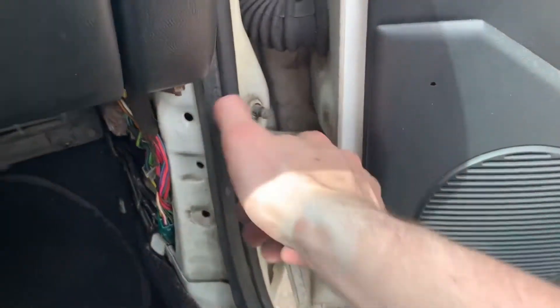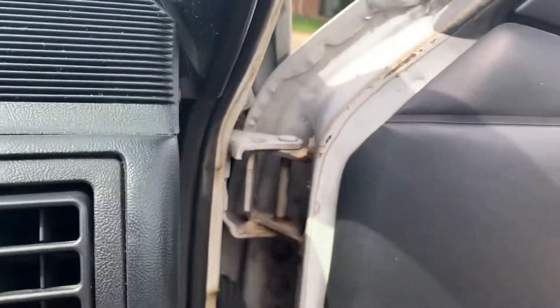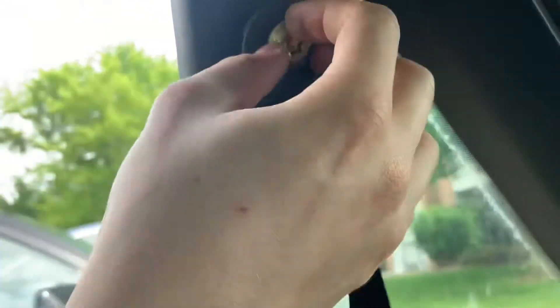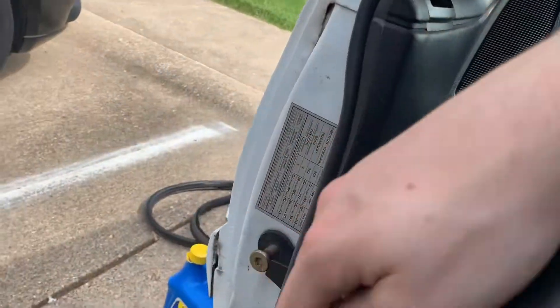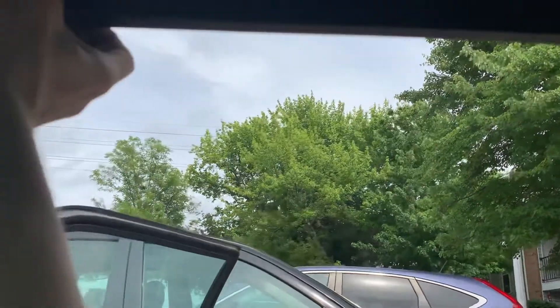This is going to be a little bit easier to show from inside the car. Four screws here, a push pin here — you just pull it out like so. That's going to free everything up. This is all just giving you clearance. Then you take this bolt out and these screws here. You're going to need a T45 Torx to take that plastic cover off. Another screw here, another screw here, and one here. Finally, you just take this plastic piece out carefully.